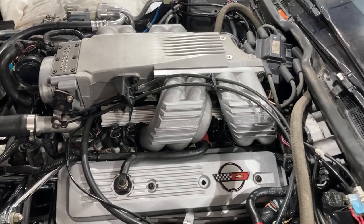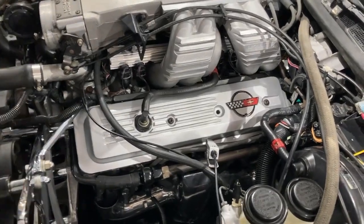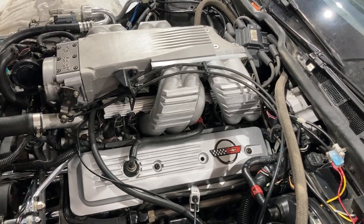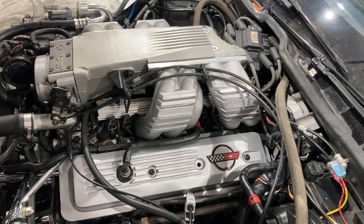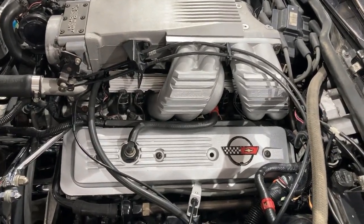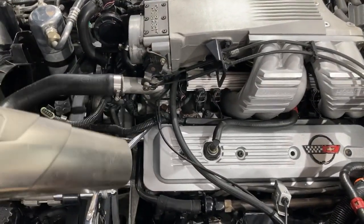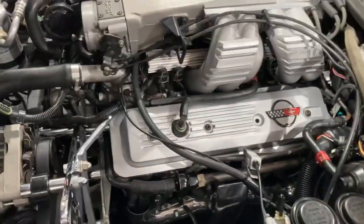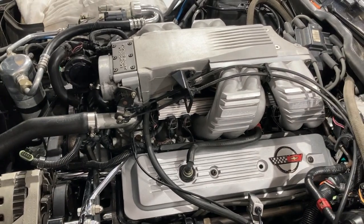You've already had that set before you get to this point. That's the Tuneport timing thing, and you can do this when the car is running too. I do this on an initial engine install because I don't want the timing to be so far off that I have an issue. Just get it close. With just the starter turning over, you can set it with the timing light — it will fire and you will see it. Just make sure you don't have any fuel going to it, because at that point it will start and you may not be ready for that.